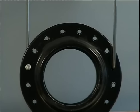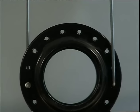The most popular number of crossings is 3 times. Here, holes 1 and 8. Left spoke head outwards, right spoke head inwards. Crossing 4 times with holes 1 and 10. Left spoke head outwards, right spoke head inwards.